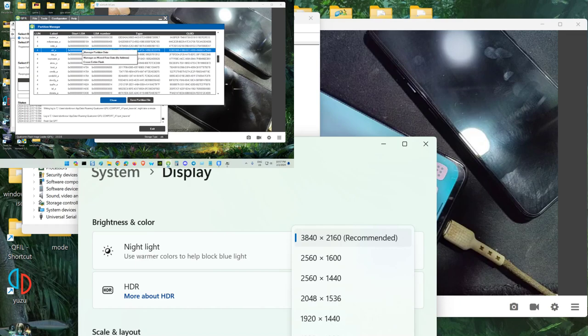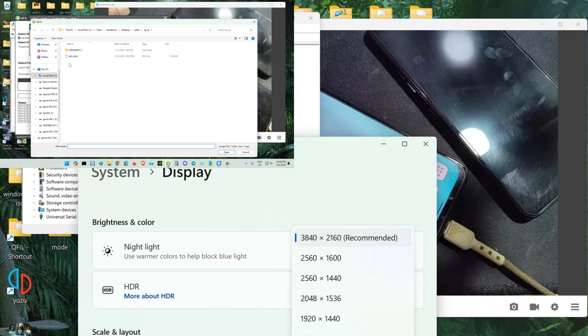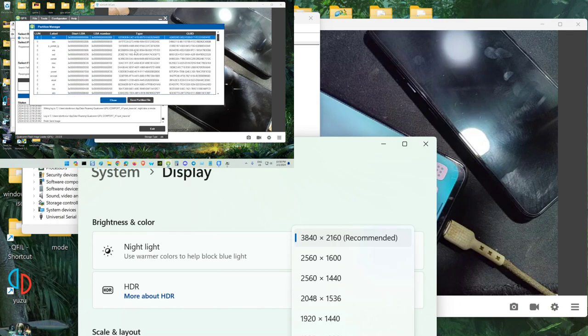Right click, manage partition, ABLA, check again, ABLA, load image. This is the engineering bootloader, a modified bootloader that has fastboot. The stock bootloader doesn't have fastboot. Open, now it overrides the current bootloader. Finish, send, close, and now the ABLB.